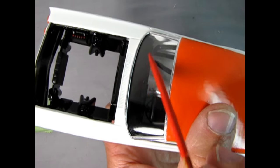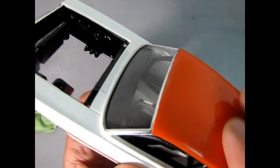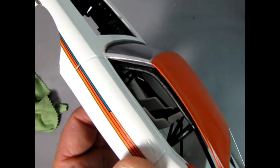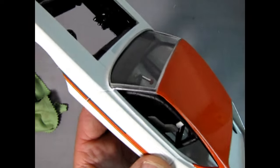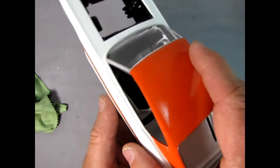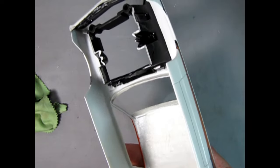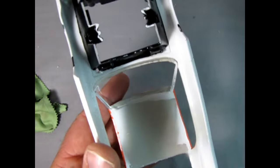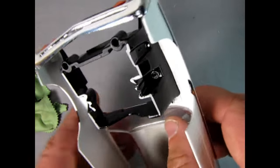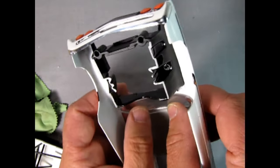And there it is. That's exactly what it needed. And those little corners that were sticking up, they just needed to be filed down at an angle to match the windshield angle inside, which you can't see because you got to go across to that side back there. But at any rate, that is what it took. This interior is now sitting up as if there was no glass in it at all, like before. And now, that windshield being in place, I just tacked it in the two corners. But now I've got it positioned so I can actually press it in, which might even make the interior fit even better.